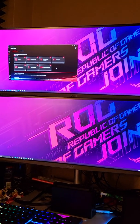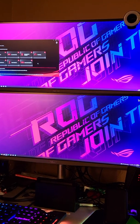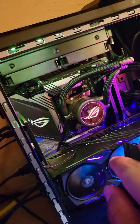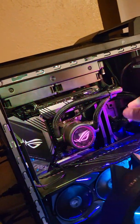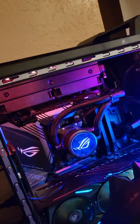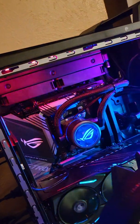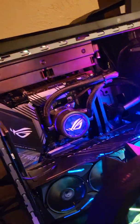Just to recap what I've done: I've been all over Reddit, Google, and YouTube. I've taken out the battery to reset the CMOS. I've disconnected the harness and pretty much disconnected everything except the water cooler off the motherboard. I've also completely reinstalled Windows 10 on this machine.